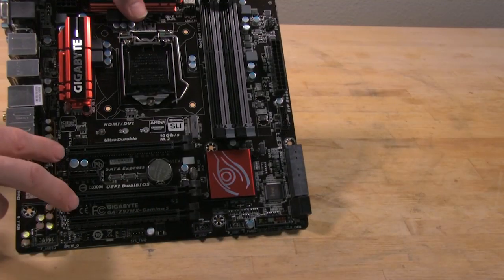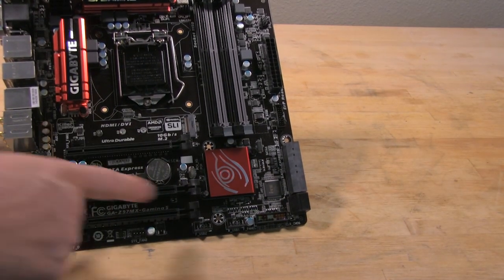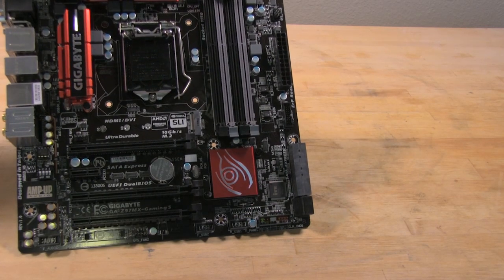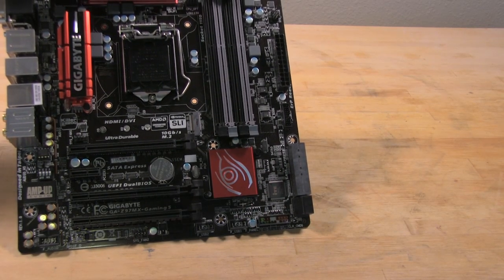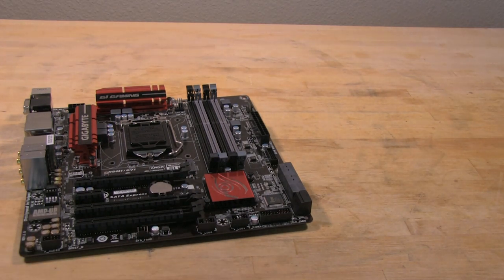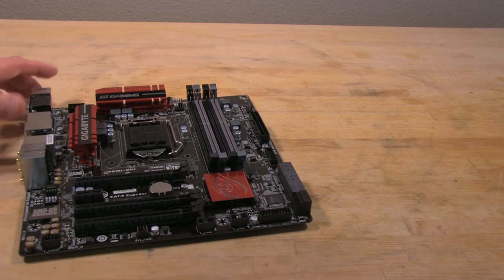It's going to be important, so when you're running SLI or Crossfire, you're going to end up with dual X8 instead of dual X16. There's a very minimal throughput hit, it wouldn't be anything that you would notice when you're gaming or running anything. Not necessarily a performance hit, but there is a throughput hit when you start looking at some of your higher end cards, especially if you want to push 4K over SLI or Crossfire.